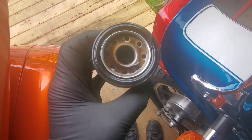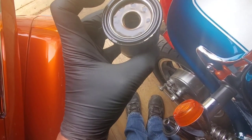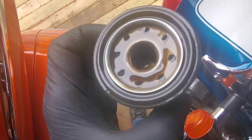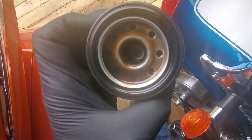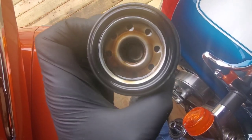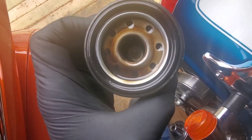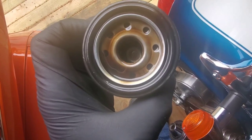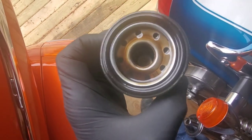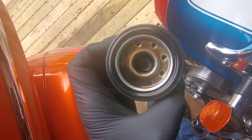There's a little better view of that oil filter — I noticed my O-ring is on there, so we're good. But look at how dirty that oil is — that's a thousand miles. So if you're telling me you can only get three, four, five thousand miles on this oil, that's what it looked like at a normal oil change at a thousand miles — I would have been yanking it out at 500 miles. That's got to be from the Sea Foam — so I had a lot of carbon deposits inside this motor at just 48,000 miles.